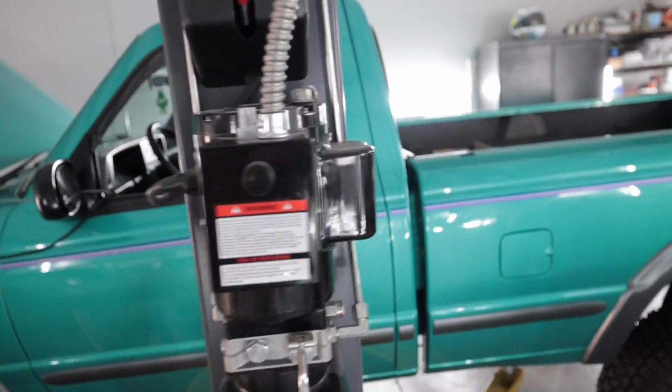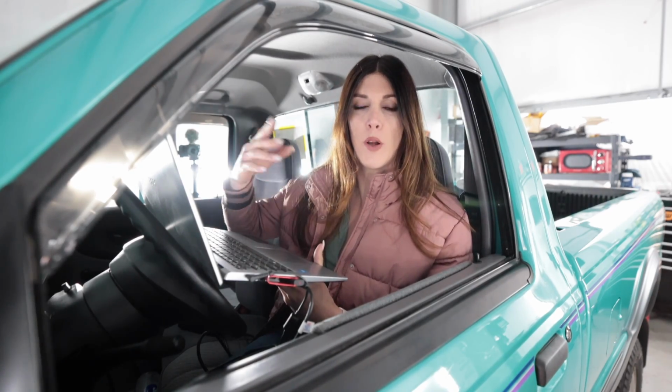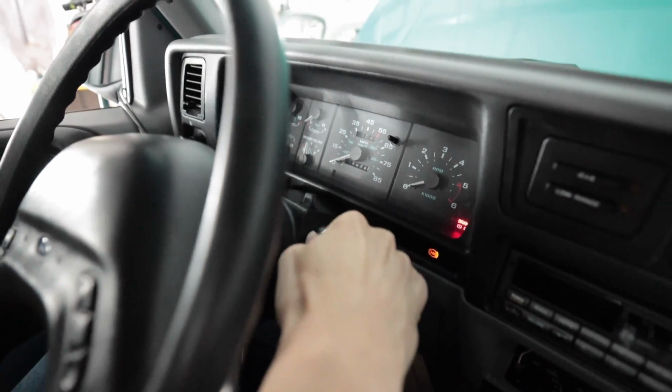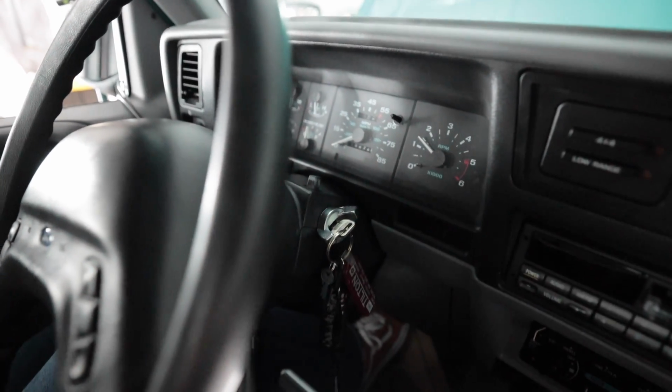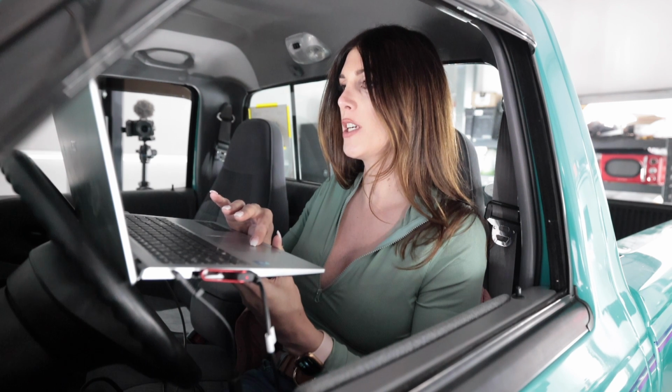There. I just screwed around for over an hour with the VE tables, trying to get different cells that I could tap here in the truck by revving it, so the AFR is correct. There is one last area to address until I can say this thing is 100% fixed from the problem it had prior to me doing the standalone, and that would be engaging the air conditioning. Fire this up. Going to turn on the AC idle up feature.